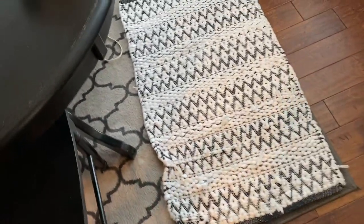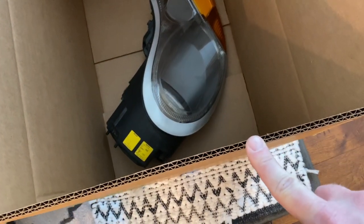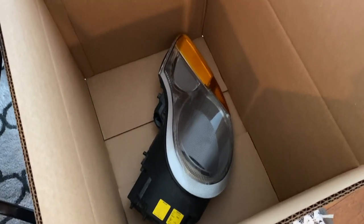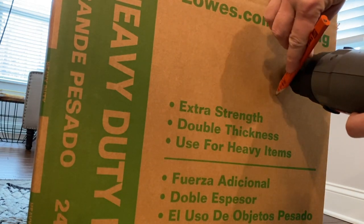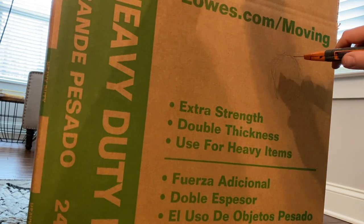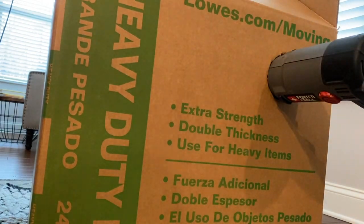Now for the box. Normally you'd do this outside in your garage, but I don't want to go out because it's cold. I got the large heavy-duty box from Lowe's — it's thicker than normal boxes and just big enough for the whole headlight to fit in. You don't want the hot air blowing directly onto it, so a lot of people elevate it from the bottom. I'm just going to put the gun up here higher and draw a rough circle for the gun nozzle hole, then cut it out with a box cutter.